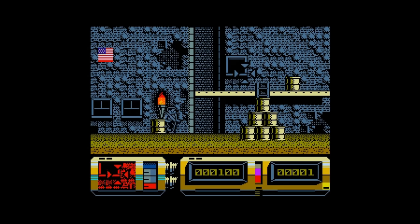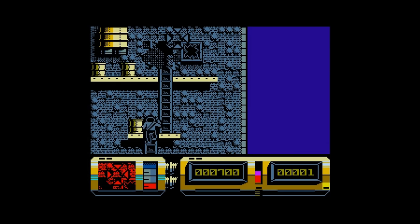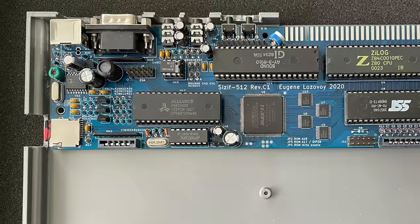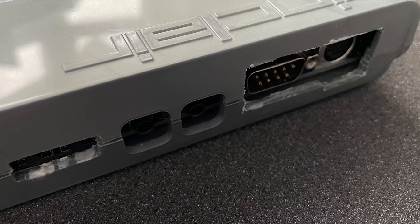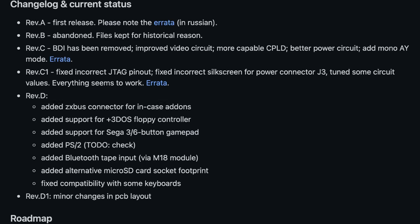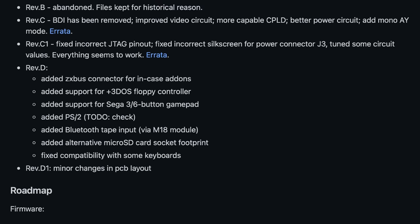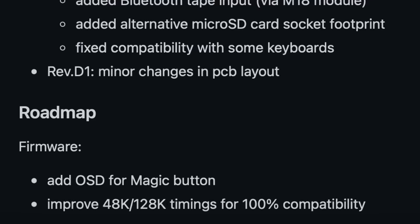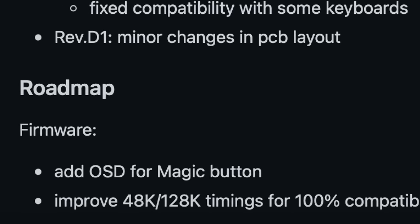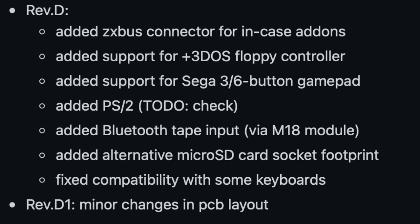From a compatibility perspective, this board seems really good, and the combination of the extra memory, the ULA+, and the ability to switch between ROMs and CPU timings means you get access to pretty much everything ever written for the Spectrum and its derivatives. You will need to hack around at a case — don't worry about the messy nature of this one, I'll be printing off a nice back panel soon, and I have a nice new case and keyboard coming for the Harlequin. The only real downside to this board is that there is very little documentation, so you'll need to join a community to learn from other users. But once you've got it all set up and figured out the magic button, it all becomes very intuitive. I know that Eugene is working on an on-screen magic menu that will pop up when you push the button to help new users find their way around. And there is already a later revision of this board with some stuff I can't bring myself to look at, because then I'll want that version too. At some point I have to admit I have a problem.